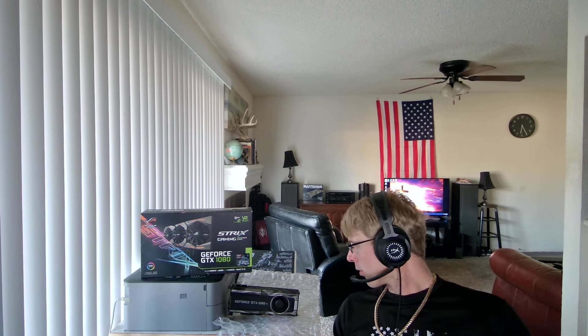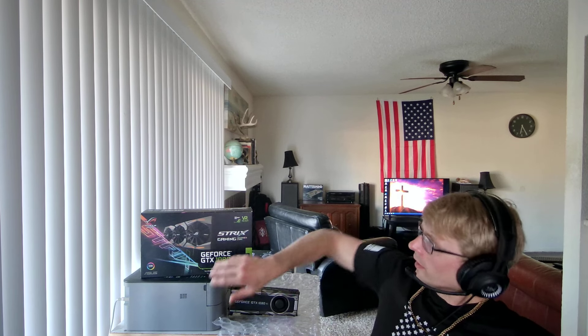So if you can pick one of these up cheap on eBay, I totally recommend the 1080 Ti — this was a special card. I think NVIDIA possibly even made a mistake with this card with the 11 gigabytes of video RAM. You're getting tons of CUDA cores, a great card. Even a blower-style EVGA model is fine — you can set a custom fan curve in MSI Afterburner, have your fans go to 100% whenever it hits over 70 degrees Celsius. You can keep the card cool and overclock these too. The Strix model I have — I got the memory up to stable at 900 MHz plus, and the core clock I'm running about 130 MHz plus. It's a great card even for 4K gaming in 2024.